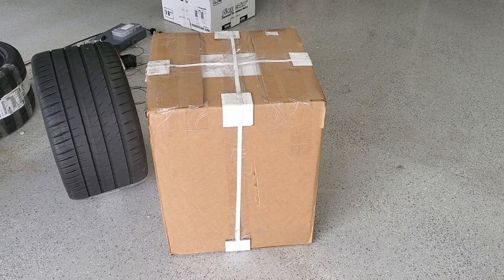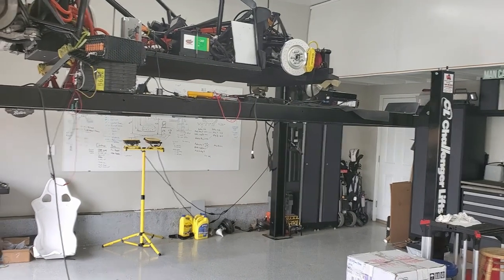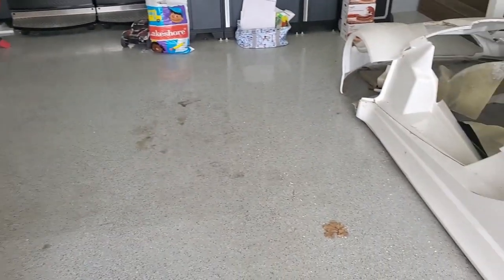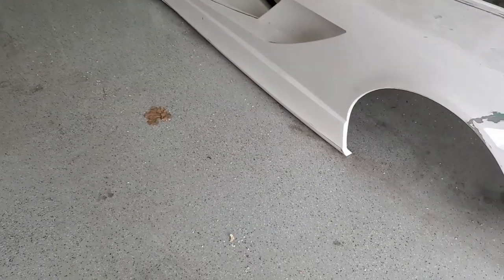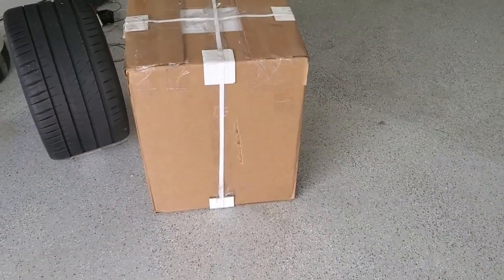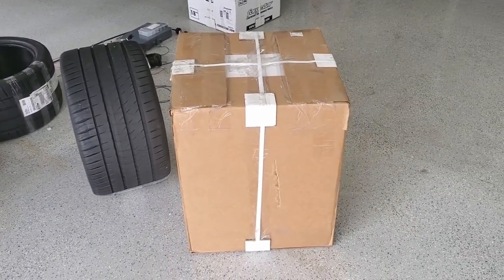It was kind of challenging because on the car we've got on the front and the back, it's a little bit different. The front — I may have mentioned this before — is a 5x100 pattern, and on the rear it's a 5x120. The biggest wheels I could fit under the wheel arch there is about an 18-inch wheel rim. The back ones I'm going to have to flare the fenders anyway because the Tesla pushes it out, and at that point I could grow the wheel size if I needed to. All that said, it was a little challenging to find wheels that matched both patterns as well as the sizes and offsets that I wanted.